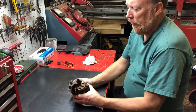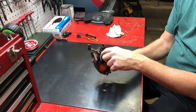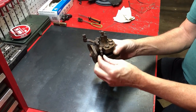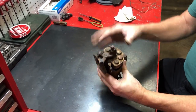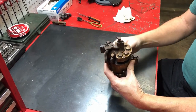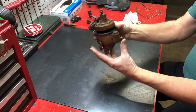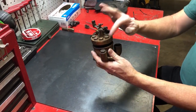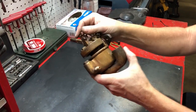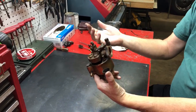This is the intake manifold side. This is actually a flooding device — they did not have a choke back then. This pushed down on the float and would actually flood the carburetor; that's how you choked it. This is your main metering valve — rich and lean. And this is your air horn. Air comes in through the bottom, up through the venturi, mixes with the gas. And then, of course, the five balls — I don't know if you can see them, but you can hear them. They were stuck. Now they're working. So this carburetor should work — we'll find out.